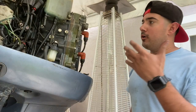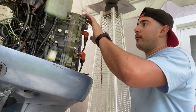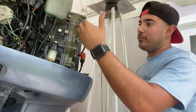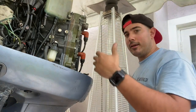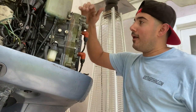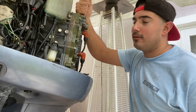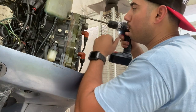We hook it back up to the hose and we notice a leak. Most of the time you're going to want to keep tightening it, but the bad thing about tightening bolts on something that constantly gets hotter and cooler is that it weakens the bolts. Possibly two years from now when you go to take it off, you're going to snap a bolt inside the block — not good. So instead of tightening it down, let's go ahead and remove it.